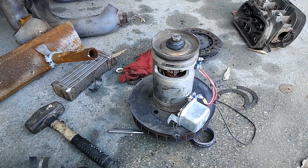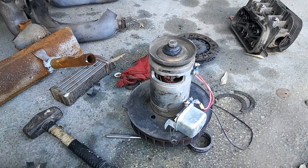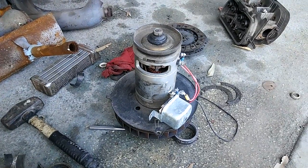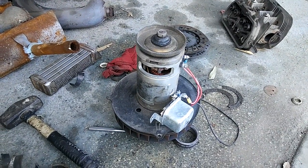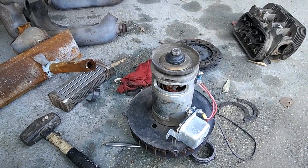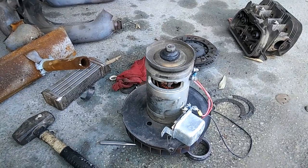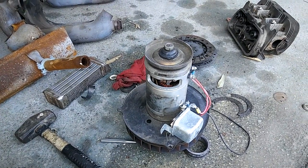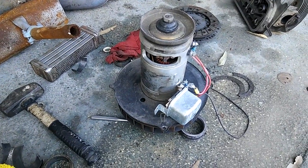You can use your six-volt generator to run your 12-volt system — it works. I did it for about a year and a half before I sold the car, so I don't really know the end result, but for that year I was driving on 12 volts and it worked. That was with a 36 horsepower motor, and a Porsche generator was no option — back then they were like $200, which is like a thousand dollars today. There's no way I could have put that money into it.